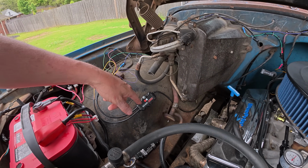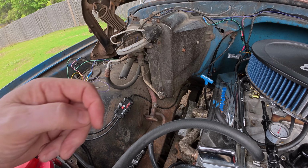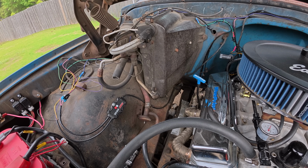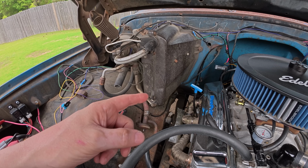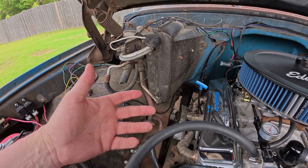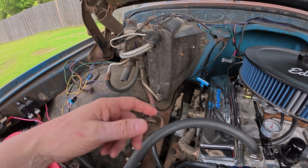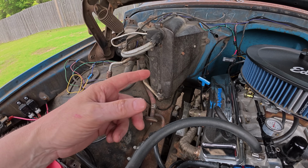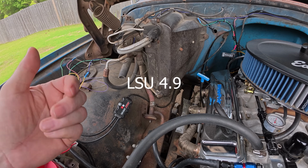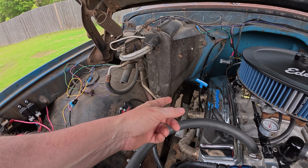They give plenty of wire to go down to that. I mean, obviously the lead on that O2 sensor is fairly long. It's maybe 2 foot long, something like that. I can't remember. That's the other thing, FAST uses a Bosch O2 sensor in the kit. They don't use a really cheap one like some of the AFR kits that you can buy on eBay or Amazon for $100-$150, where you don't always get the highest quality sensor. This is a Bosch 4.9 LSU, I believe, or whatever is the most current version of that. But very, very easy to route.